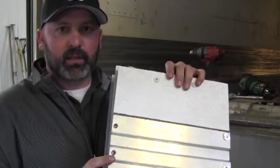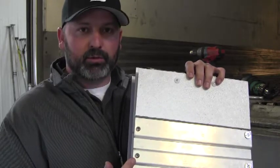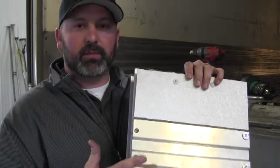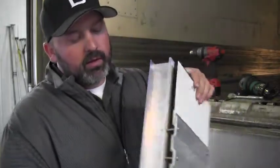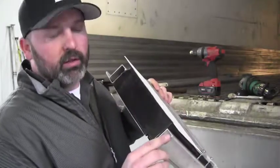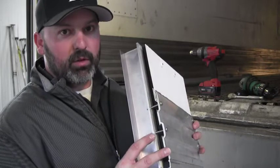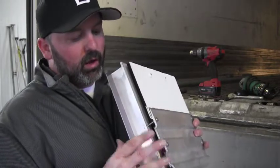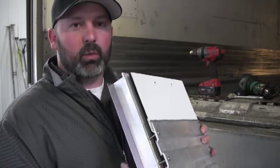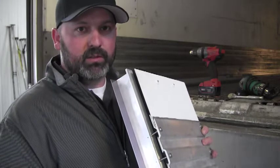Now, there are issues with this system. First off, the pan head extrudes from the wear band, which would allow product to hit it, pull it, damage it, break it, and so forth. Then, as you see, where it comes through the post is relatively thin, which does not allow for much gripping strength on the post. Also, by drilling into the post, you're drilling holes that were not intended to be there, and it compromises the integrity of the post itself.